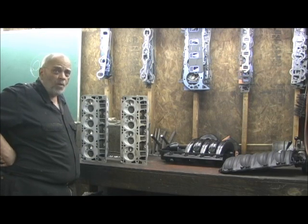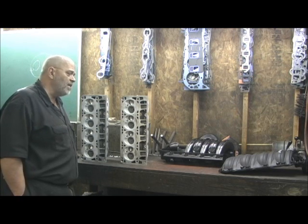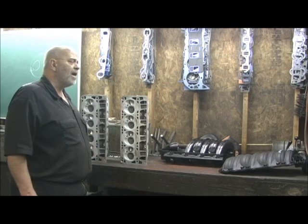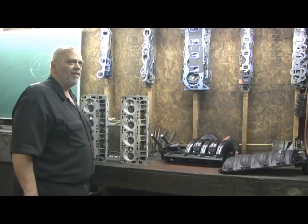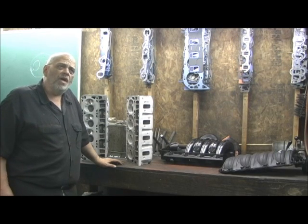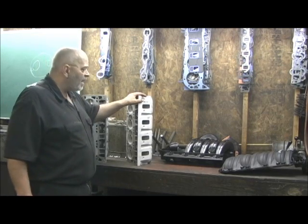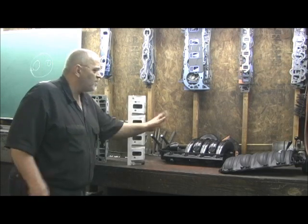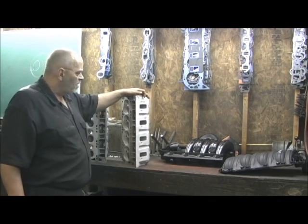I've been doing this professionally for 25 years. This is all I do, and way before that I had knowledge of it — I'd say 10 years before that I was into the head thing, studied them, read them in magazines, been around it all my life. To watch the evolution come to this point right here, it's just incredible. What you're looking at here is pretty much similar to the 1992-93 18-degree Chevrolet head. GM has been real slow to keep up with the technology, but getting this deck surface, raising the port up, tilting it — well, that's just everything. That's what race heads have been doing for years, and now finally they're doing this with this.